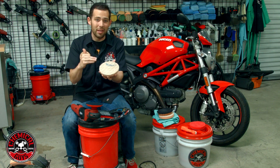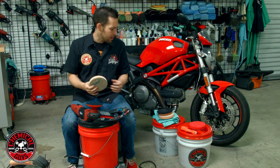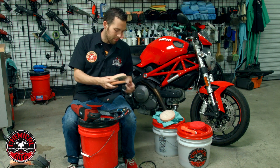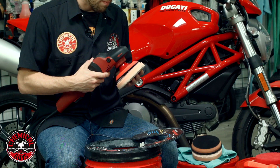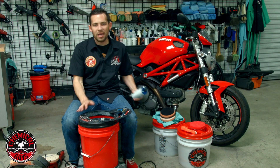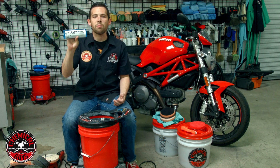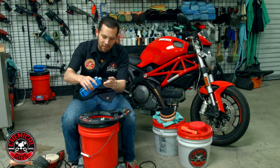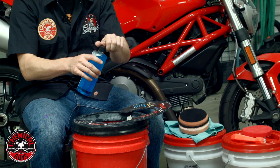This is a real dirty pad — extremely dirty — and we're going to go ahead and clean it off. For some reason this one has some type of staining on it; hopefully the pad cleaner will clean this off. We're also going to clean a microfiber pad and a pad I was just using that I need for a video we're filming next. First, take your buffing machine — we're going to use a rotary polisher — and place your pad right on it, make sure it's centered. Now I'm going to add our cleaner to the bucket. We're going to be working with the Chemical Guys SoFast Pad Cleaner. You can spray this directly on the pad or add it to the solution — I'm going to add it to the solution. You need one ounce to five gallons, so I'm going to add two capfuls to this bucket. That'll give you enough cleaning power to scrub the pad clean.